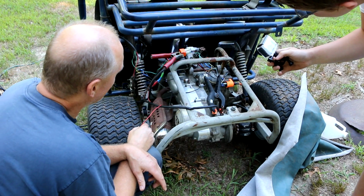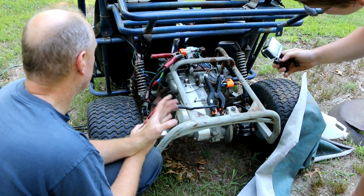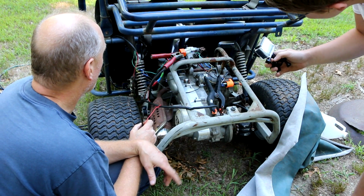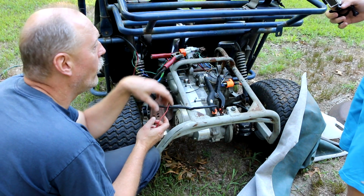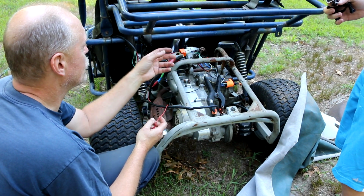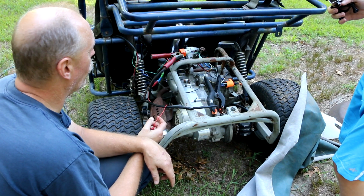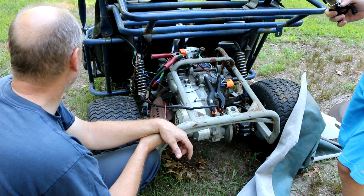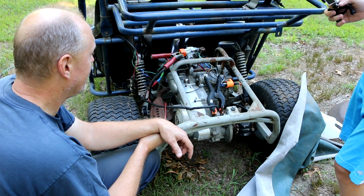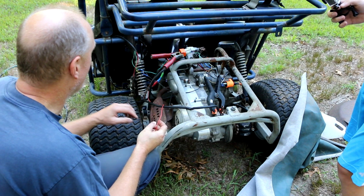That's a good sign. So tomorrow, hopefully, we'll throw the carburetor on it. We'll put enough fuel in the carburetor so that it's in the bowl. And you should be able to run it off just the fuel in the bowl of the carburetor without even having to hook up any fuel tank or anything for a minute or so and see how it acts. But, I mean, that's a really good sign.